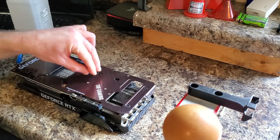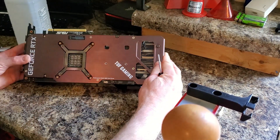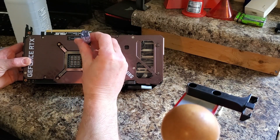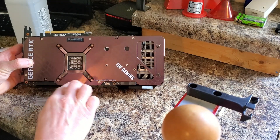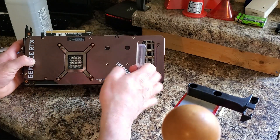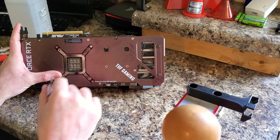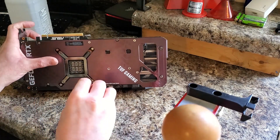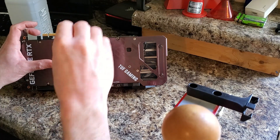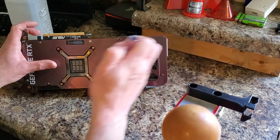That pad is keeping this up at the moment, but we'll see what happens when everything's been squished down. When you go to start these screws, you're going to have to start one corner first — that's the only one you'll be able to feel the threads as they go in. You do not get the luxury of hand-starting these screws. Start at one corner, get that one started, push on this corner and very gently turn that screw until you feel the threads engage because you do not want to cross-thread these. Then work the other corner, get the screw started, do the same to the opposite corner. Once you've got all four started, you can then do your X-pattern tightening, just a couple of turns at a time. Really important you don't strip these out.